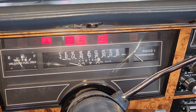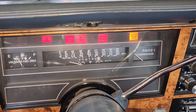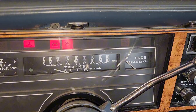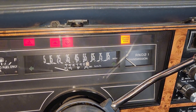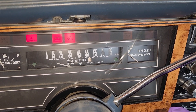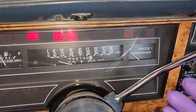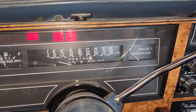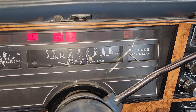Now we just have to look at the manual, Google it, or ask a friend who knows GMs to figure out what code 24 is. I looked it up — it's a vehicle speed sensor circuit open, which makes a lot of sense because our speedometer isn't working. So if we figure out how to fix the speedometer, that'll probably clear the engine code and this thing will be pretty much brand new with only 114,000 miles.